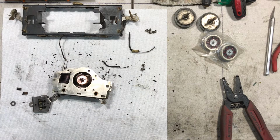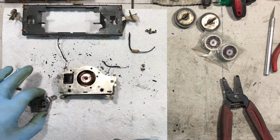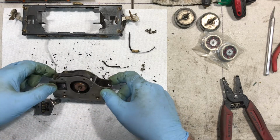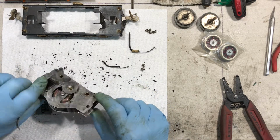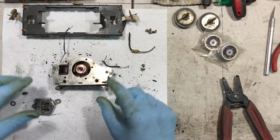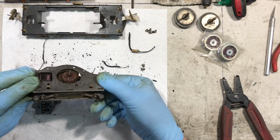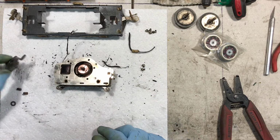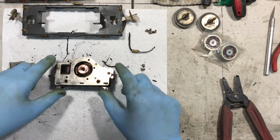Okay, I'm back. So where I left that, a lot of degreasing had to happen. So we cleaned this all up. I think it looks pretty good. The armature's been cleaned, got inside, cleaned it up in there, took the gear off, cleaned both sides, cleaned everything up, washed out well, gave this a little brushing. I think this will work well. But the roller, cleaned up the brush plate, the brushes, and the little spacer.